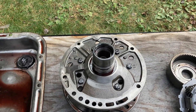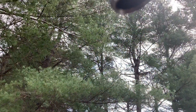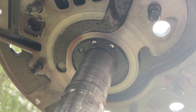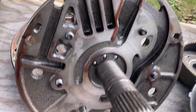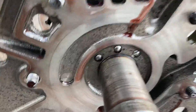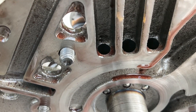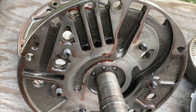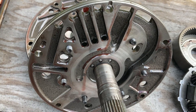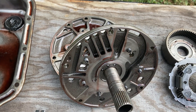I'm not the transmission pro, but I was taught to do this years and years ago. You can see those three check balls right there. I was taught to take the one on the far left out when using it in a non-lockup application. The way I would do it is: if you look at this passage here, I filled that with grease and smacked a punch in there about a half a dozen times until the hydraulic pressure drove that check ball out. I don't know exactly what that passageway goes to or does, but I was taught to do it and that one worked a really long time like that. But we don't need to do that because we're not using that wider, heavier drum.